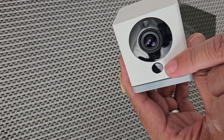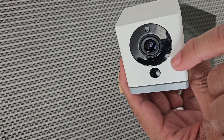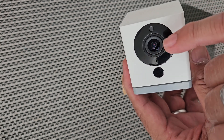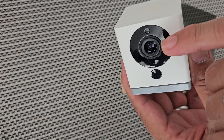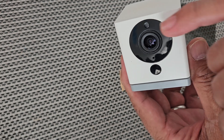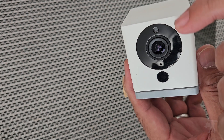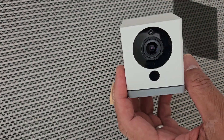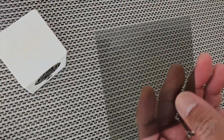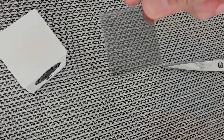You don't want to be covering up the infrared sensor over here, and there's also a light sensor on the camera. So cover up as little as possible — just the camera part, which is that small lens in the very center. Around this are infrared emitters, sort of like little infrared LED flashlights. Unfortunately, we'll probably have to cover those up to accomplish what we need. So the first thing you want to do is cut this down to size — you can just use scissors, and I've already cut a fourth of this out, so this should be closer to what we need.